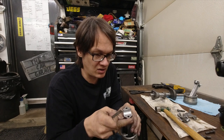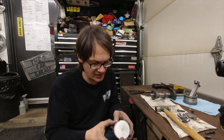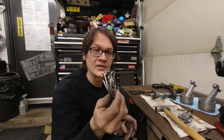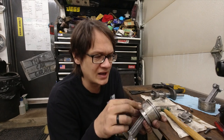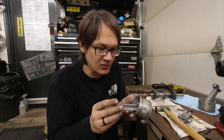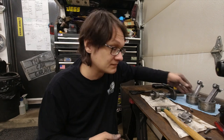I'm going to pull these rings off now because we're not going to be using those — those are going to get tossed. Now really all we have to do is get the pistons and the rods cleaned up. I haven't taken the piston off the rod because they've got these little expansion plugs that go in here to hold the pin in place, and I don't want to have to try to refit any of that, so we're just leaving it together. I'm going to clean this and immediately throw some oil on the pin to make sure that's good, and we're going to call the pistons and rods done.